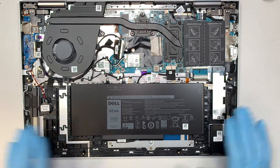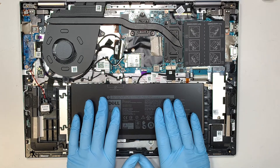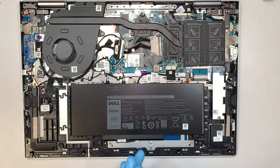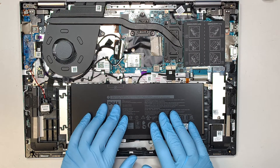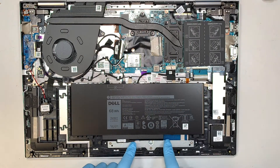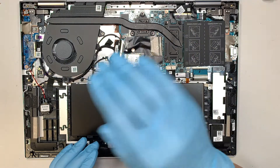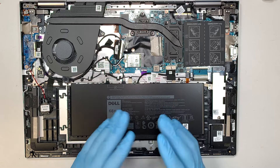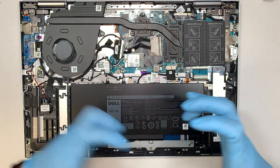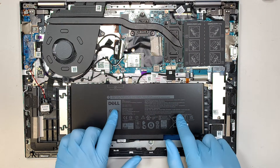At this point you can see the battery at the bottom. Now let me explain a little bit: if you feel like the battery is not holding the charge — meaning the battery fully charged at 100% only lasts you less than an hour — that is a sign the battery is no longer holding the charge and it may be time for replacement. Also, if your trackpad is not clickable, or if you feel like the trackpad or the laptop is bulging — meaning the battery from the inside is pushing the back cover and the trackpad and expanding — then it is most likely coming from the battery.